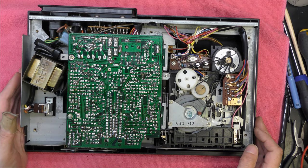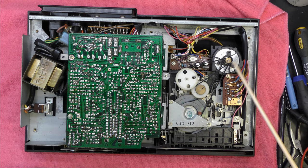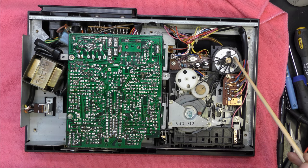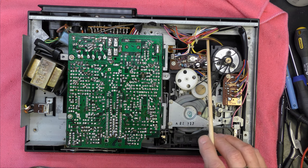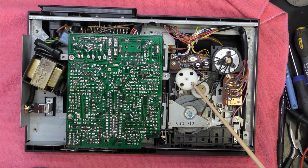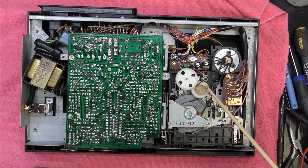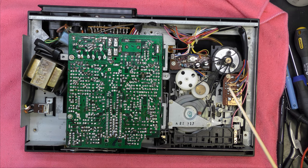Okay, so what have we got. We've got the main audio circuit board on this side. This motor looks interesting — according to the circuit diagram it's actually got a frequency generator on the back of it, and you can see the screen cables coming in here as well as what looks like the DC cable, so I wonder if that is proper feedback — it does look like it. Well, that belt looks quite loose. This looks like it might be some sort of auto-stop mechanism. I guess your typical idler there for fast forward and rewind, and yeah the belts are quite loose. I like the screened transformer to minimize hum, and of course it's as far away from the deck as you can get.